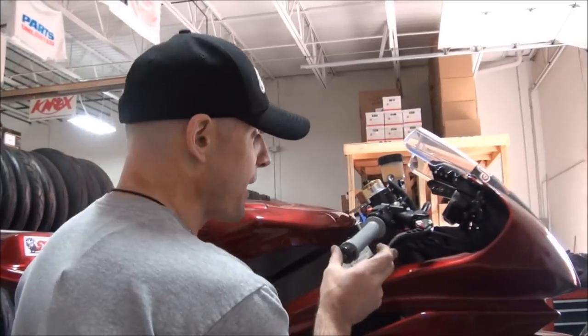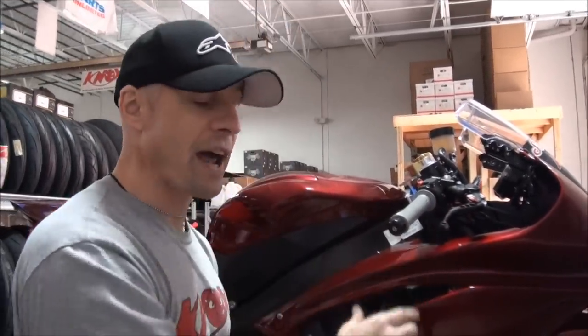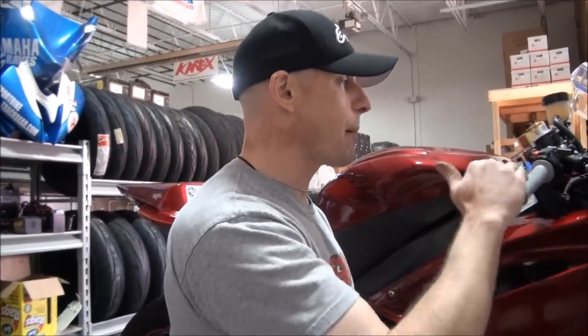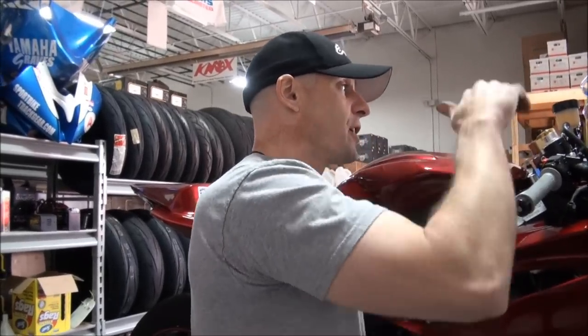One of the last things I'll typically do on one of my race bikes is, once I'm totally done with the job and the motorcycle is going to sit on a stand for a day or so, or it's going to be in a trailer heading out to go race or ride, I'll take the brake lever and put a zip tie on it with the brake applied. What that does is hold the hydraulic system open — if there are any air bubbles on the other side of the master cylinder, as you're traveling or the bike is sitting, they'll naturally work their way to the top, past the master cylinder, and the air will end up on the other side of the brake fluid, giving you a perfect lever.